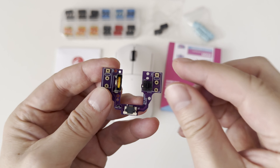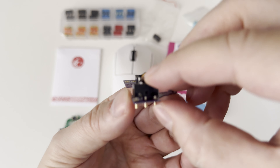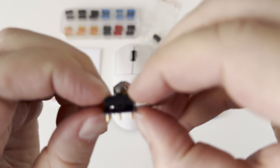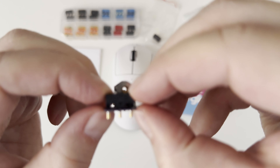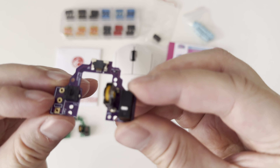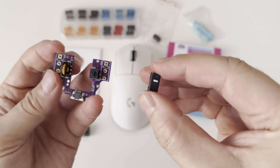The last option is to get the hot swap module with TTC yellow core encoder for the scroll wheel, which is already soldered into the board with sockets for switch pins pre-soldered as well. The benefit of this hot swap module is that you can just plug in the micro switch without soldering. Let me try plugging in the Omron 10M switch — you can see I have to apply force to install it properly into the pre-soldered sockets. This hot swap board can be used to test a variety of switches to find the best one for your click technique and to improve your click speed. The board is a little thin, so be careful not to damage it. Removal of the switch from the board is a little harder, but I would not expect to change the switches very often.